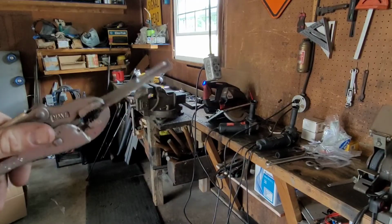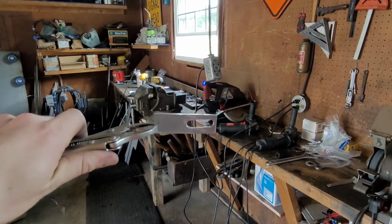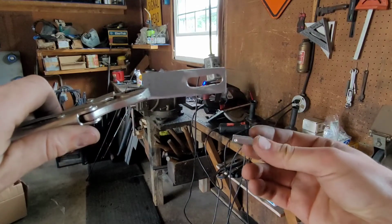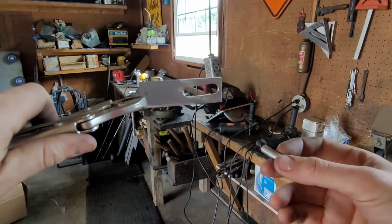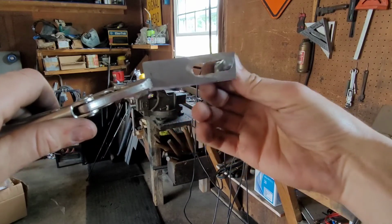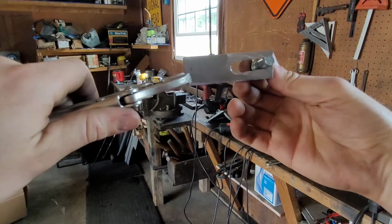Okay, so I have two of these made. The other one's over on the workbench. These weld to the linkage rods on those long nuts that I was telling you about, and the pin that goes through the rod that the lever controls. It allows the rod to move further than it needs to, and when it gets to this point, it'll actually pull and apply the parking brake.